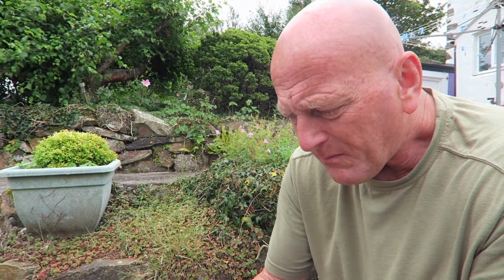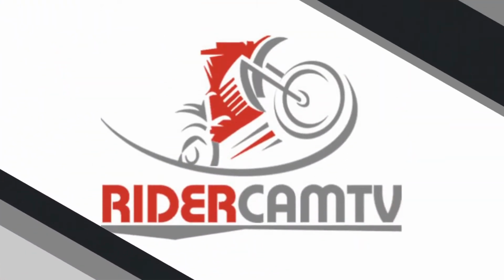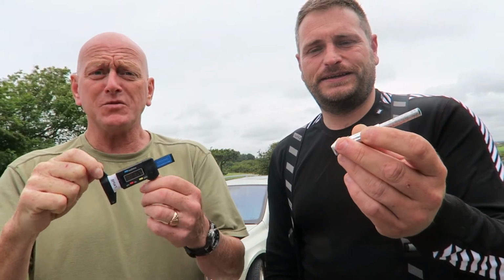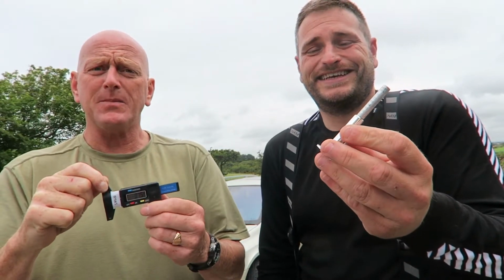Just keep an eye on them, make sure the tyre pressures are correct, because people don't look after the tyre pressures on their tyre enough, and they say, oh, my bike's got a wobble at a certain speed. A lot of it is to do with tyre pressure. And you'll find some tyres get a bit like a bobble on the actual tread itself. We get them quite a bit on the blood bikes, because sometimes the tyre pressures aren't checked regularly enough, although they should be. It highlights very quickly because the bike is being used all the time, and the way it changes the handling of the bike is quite extreme in some cases. That's how we measure our tyre depth using these tyre depth indicators. Not complicated, must be simple, we do it, but it's something you really must keep a handle on.